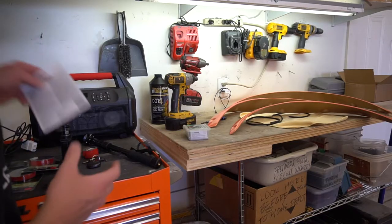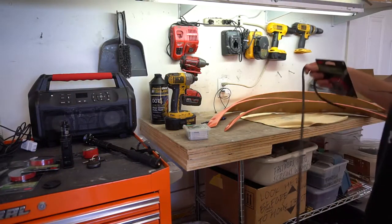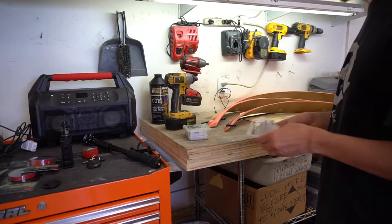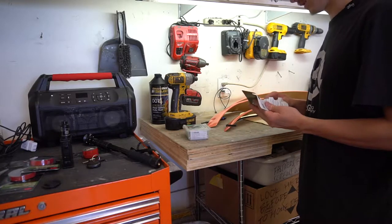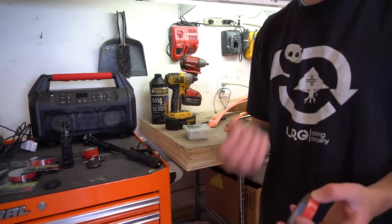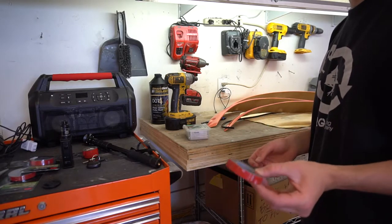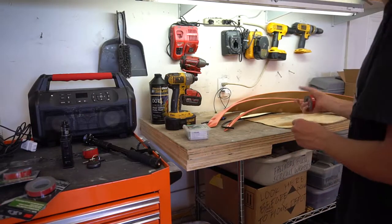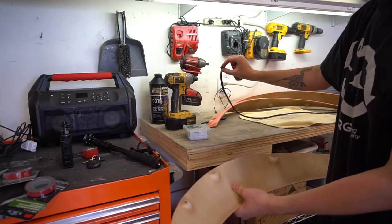All right guys, we're getting the flares done, and I'm just trying to figure out how to mount the, well, I just figured it out actually. So we're trying to mount the weather stripping that I got to go around the edge of the fenders. I was trying to brainstorm ideas in my head, ended up going with the same method I used for the wing. Just because I want this to not be permanent, because they are wrapped, so I feel like 3M is gonna be easy enough to pull off the back of the fenders and pull these off if I ever need to redo them. So I think this is the best method to go. I just got three more packages of those. And I'm just basically gonna line the back side of the fender here and then attach my weather stripping.